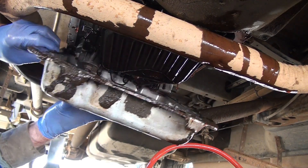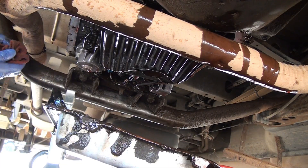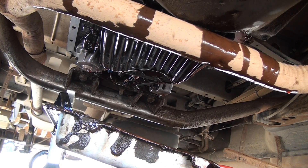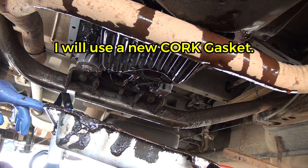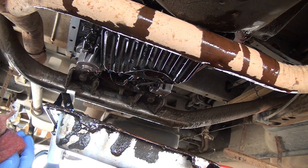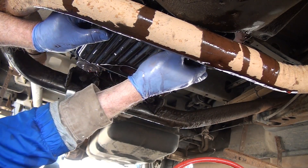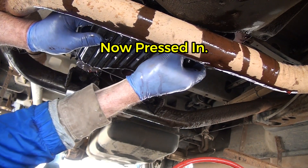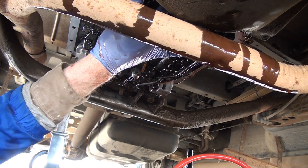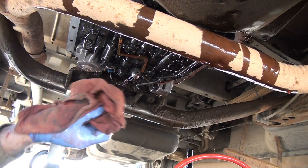It seems to have a rubber gasket, so it may have been replaced before. I'm going to take this pan out, clean it up, put a new gasket on it, and then wedge it back up in there. I'll put a new filter on while I'm at it. When you take the filter loose, some of these old styles had a clip, but it's basically an O-ring stuck up in there — you want to make sure you get that out. I'm not sure I got it; I think it's stuck up in there, so I'll have to go get a little pick to get it out.